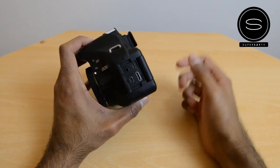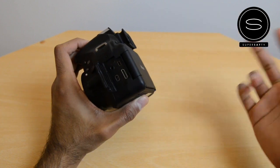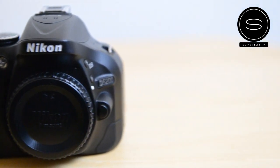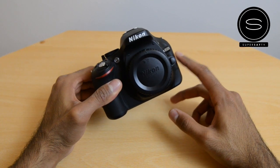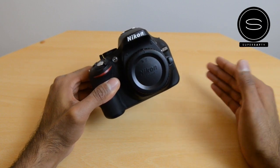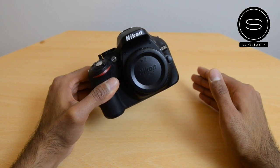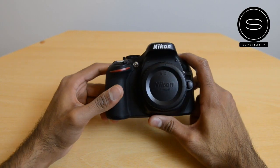I've got one of those adapters lying around — what it allows you to do is beam images from the camera wirelessly to a mobile device. Another key feature of this camera is 1080i at 50 and 60 frames per second, making it the only Nikon currently capable of this. It is 1080i, not 1080p — so interlaced, not progressive. Progressive 1080p tops out at 25 or 30 frames per second.